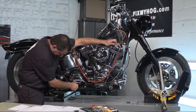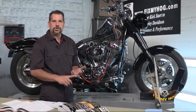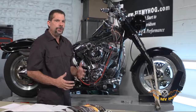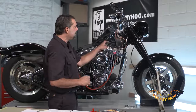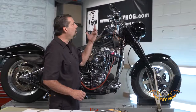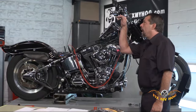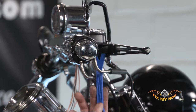Common sense plays a big role, whether it's regular maintenance, service, or electrical troubleshooting. Know what you're troubleshooting. Don't just start probing around — chances are you can cause more damage than good if you're not probing on the right side of the connector or even in the right circuit path. This is telling me that this switch is either not functioning or not working correctly. So what I'll typically do is look up into the switch housing, locate the end of the switch, and carefully actuate the switch manually.